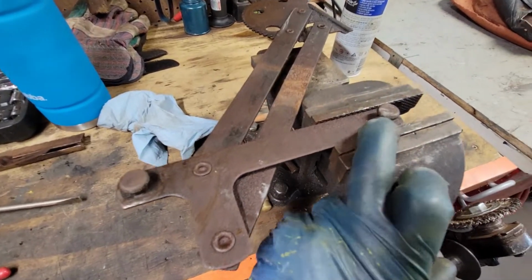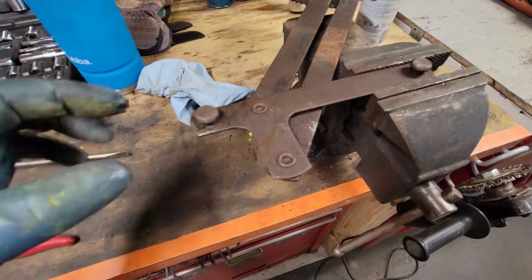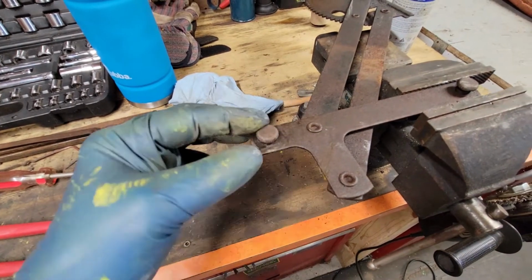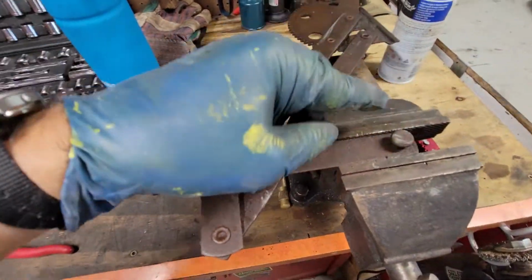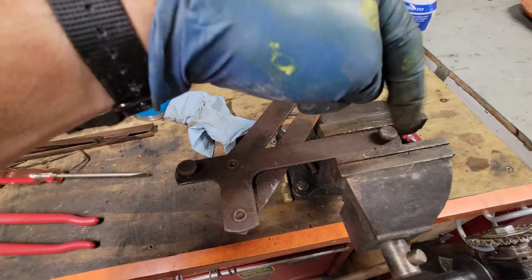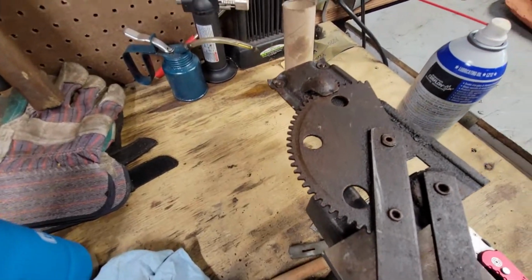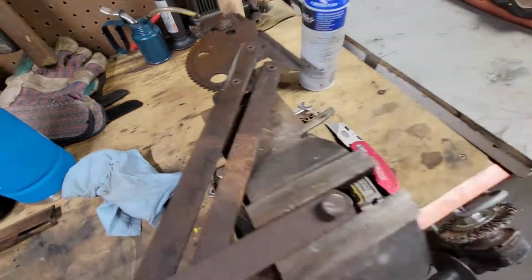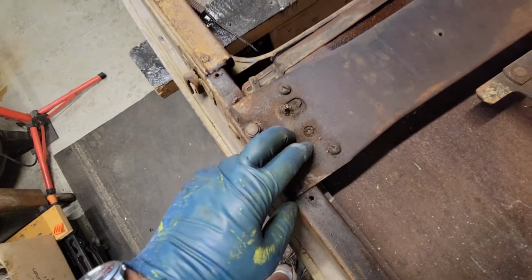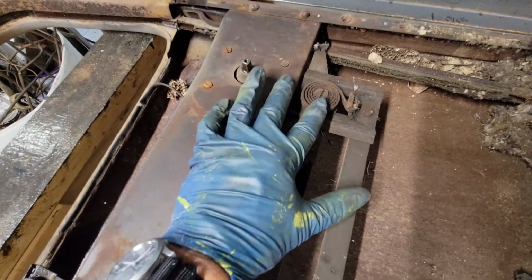I think what I'm going to do is take these out and get some nylon rollers the same sizes. I got new sash pieces coming. So when those get here, I'll size up some little brown nylon things and then mount those in place there. That way they will spin. And I think that'll just make your window go up and down so much easier. But everything was greased up well, I'll give it that. Of course, it's protected up in the door. On this side here, I haven't taken out yet. But, it's over here. But this has got a good spring in it. But I ordered a couple springs. The other side the spring was broken.